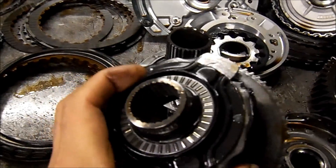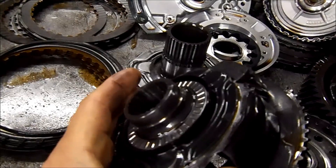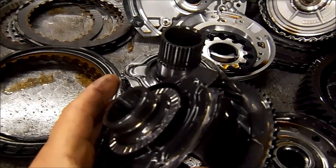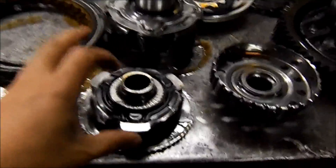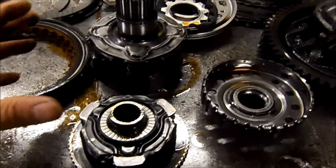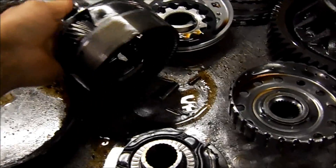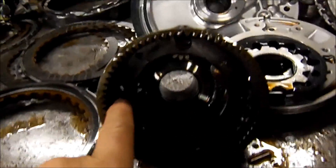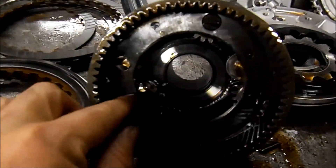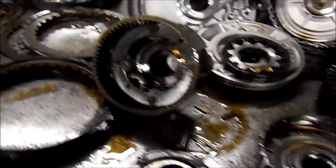A combination issue is that this planetary gear right here gets stripped from the splines. You will always see it on the heavier vehicles like the Endeavor and the Hyundai Santa Fe, which has the same Mitsubishi transmission in it. You will see this planet strip, and also you will see that both planets get destroyed. One of the pins fell out and the pinion gets worn out where one of the planet gears just falls off.